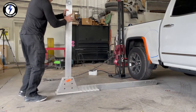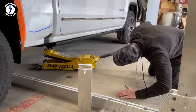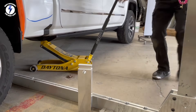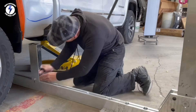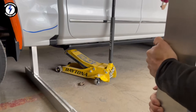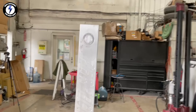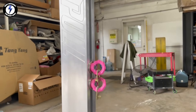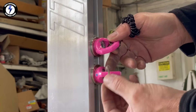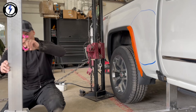I'm pushing the tower forward to remove the slack. Setting up tower number two — I'm sliding in the perfect pull tower. Now I'm grabbing the shop Daytona jack. We need to lift the frame and slide in the spacer. The post is getting lined up dead center with the dent, making sure the post is locked in and ready for some pulling. Look at that aluminum engraving — isn't it a beautiful sight? The bottom eye bolt of the second tower is lined up.